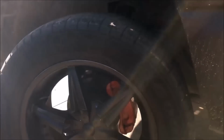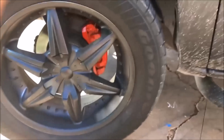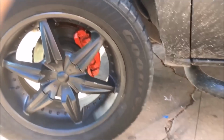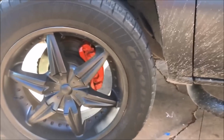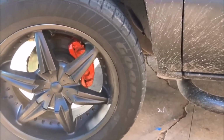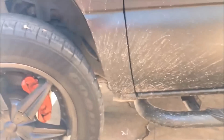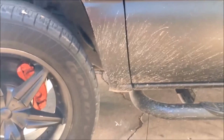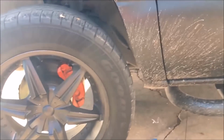The paint that I use is Rust-Oleum paint. I just made sure it was oil-based paint because I noticed that water-based paint will wash off when you wash the wheels with water, so that's why I didn't go that way. I've already painted tires before with an oil-based paint, and the paint has lasted for a really, really long time. If you're out mudding and stuff like that, then they'll start wearing out. But yeah, guys, I'm going to start showing you how to do it.